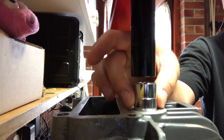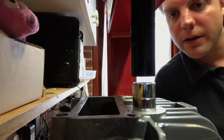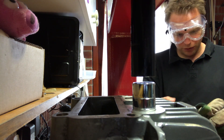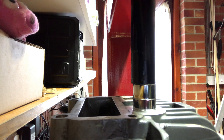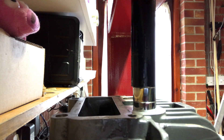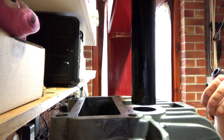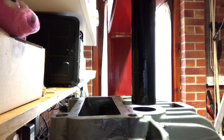I've got a 17mm bolt here which can't move anywhere at the bottom and fits nicely inside. All I've got to do is get it centrally lined up so we've got good purchase. I've got my goggles to protect my eyes, and I'm going to wear gloves. And out it comes — well, that was remarkably easy. There we have our old needle bearing, easily removed. Smells horrible.